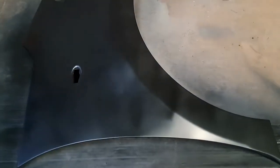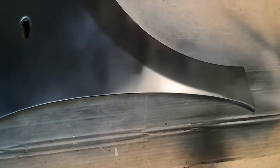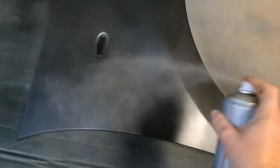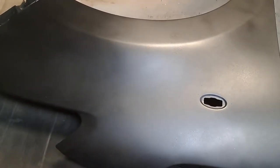Right, so first light covering of lacquer — it's a little bit patchy but that should be okay. Always do a test patch first and then just do a light coating of lacquer. I'll probably need about four, maybe five coats to get some shine. Leave it 24 to 48 hours and then polish it to get rid of any orange peel effect, which also gives that extra bit of shine to match the rest of the car. Just go around the edges quickly.